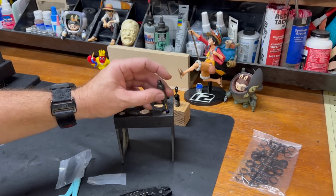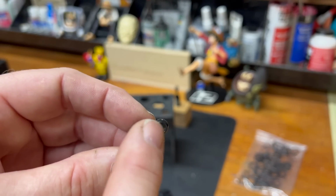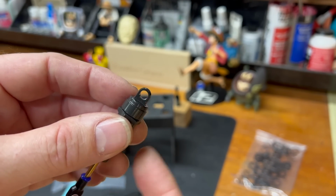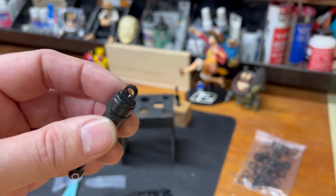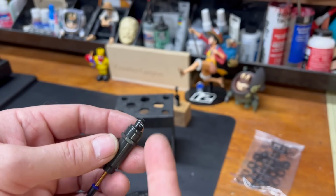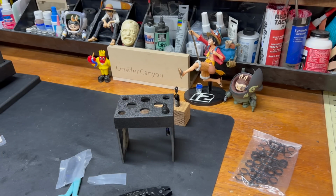Or you can indeed do it yourself. You can just sand this off, and then there's a little dimple in the middle from where it was machined. You can just drill a hole through and bolt a rod end to it. I don't have a problem with them being run like this, so I tend to just run them that way.